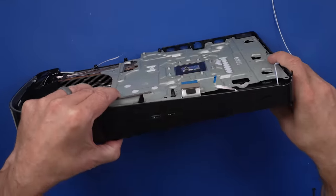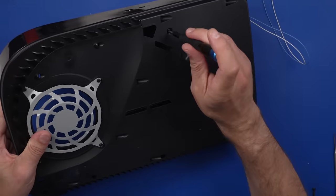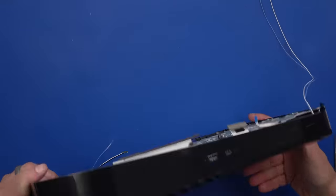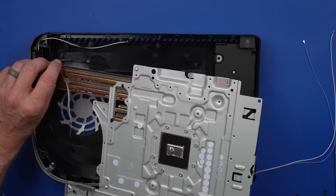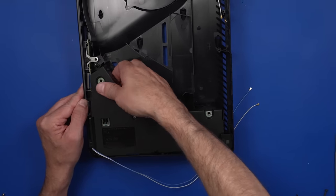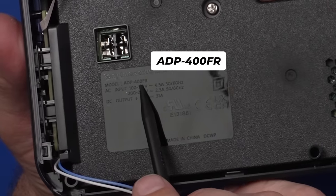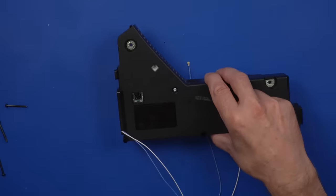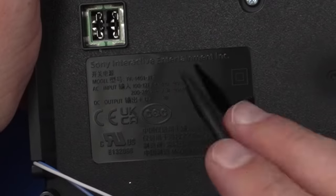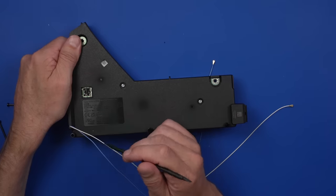So the only thing left is to have a look at the power supply. I've got one screw here, two screws on the bottom side, one here and one here. Don't lose track of these screws if you try and do this yourself, because these screws are a little bit longer than some of the others, and if you mess it up, you run the chance of putting the wrong screw in the wrong hole on the board and making a hole in the board. Now this metal plate can come off and then we're down to the power supply. To remove the power supply, we just need to push that way just a little bit and then we can just pull it right out. The non-special edition 1215 has a model ADP-400FR, and the power supply from our special edition is the exact same power supply but with a different number — PA-1401-JT3. So the good thing about this is you can use these numbers interchangeably with the previous part number, so either number will work if you need to replace yours.